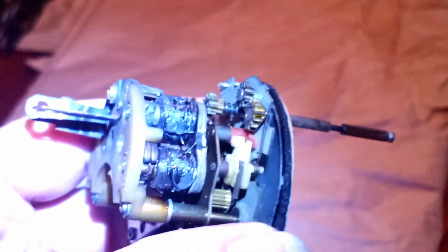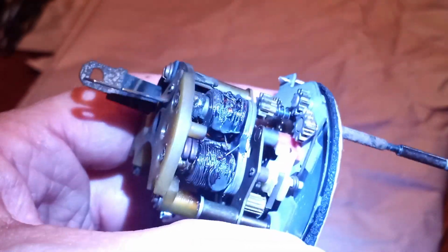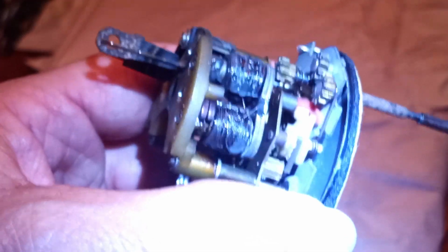So I think this one might be worse. Let me see. Ah, yeah, you kind of see just how fried this is. Under normal light, I mean, this has been totally cooked. So the only way to fix this is to completely rewind, strip off all the wire, get some insulated or varnished winding wire, rewind these, and solder everything back together, and then it should work. There are different things that cause this kind of problem, and I'll detail it in the description as opposed to wasting a bunch of your time right now.